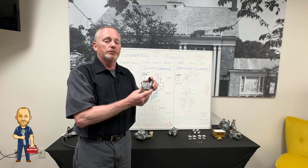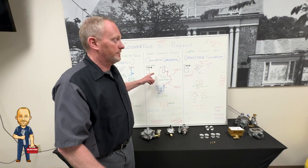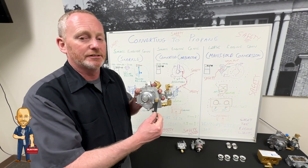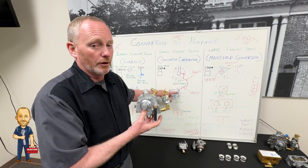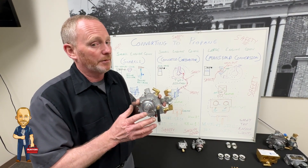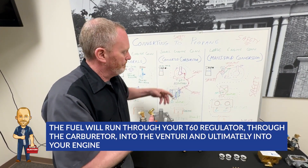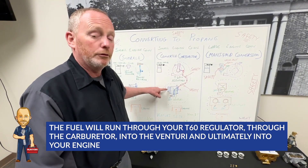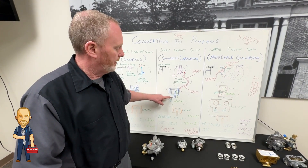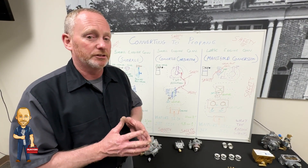We have a jet here and we use your original venturi, which is really important. We come out of the propane tank into our T60 regulator. This regulator is really important because it has a safety feature: if you're not drawing vacuum from the carburetor while the engine's running, it will not let propane flow. This is a big safety issue everybody needs to pay attention to. Your fuel runs through your T60 regulator, through your regular carburetor and venturi, into your engine — controlled by your jet at the bottom. Your jet and your venturi determine how your engine's going to run, and you need to work with those to get an efficient running engine.